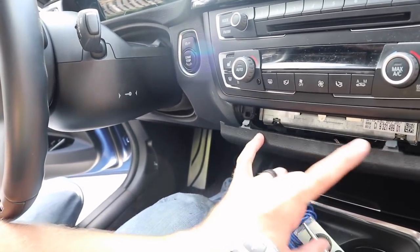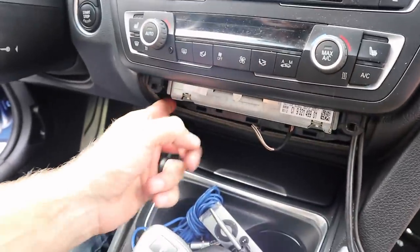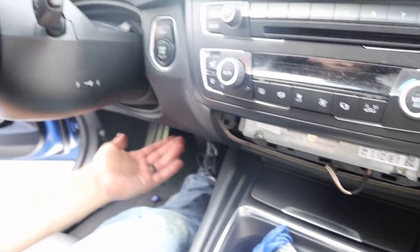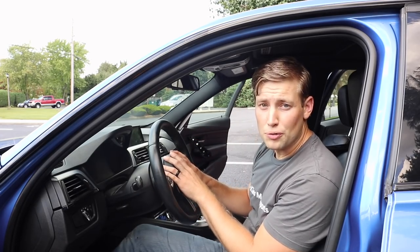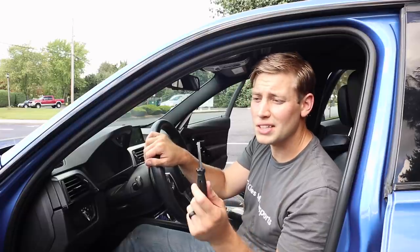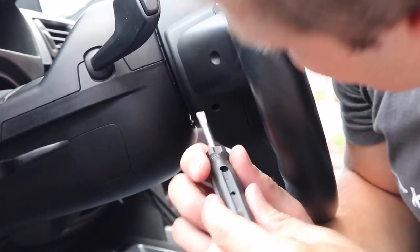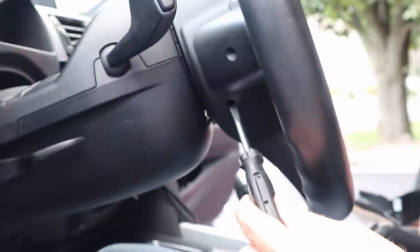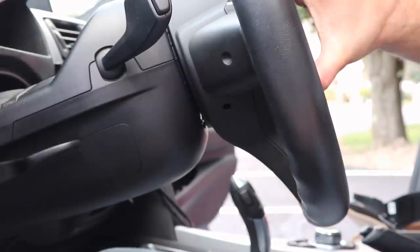You can feed a hanger or wire feeder down here, pull the wire up, then push it down so the wire ends up right where you need it. Now we need to remove the airbag to remove the wheel. You'll just need a small flathead screwdriver — one may have come in your car — or you can use an Allen key. There's a little hole right here: stick the screwdriver in straight and it will release a clip.